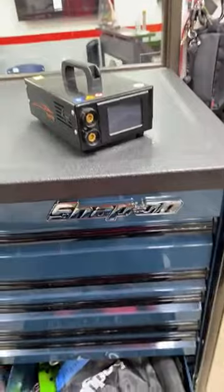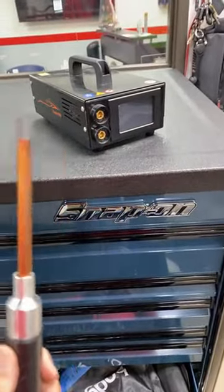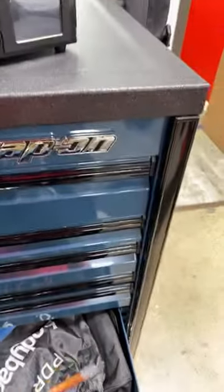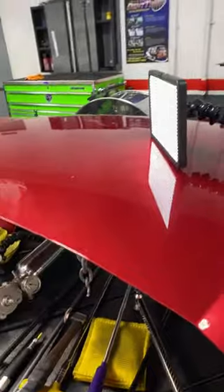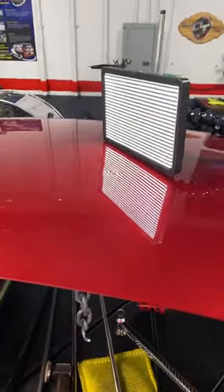Right, and we have to actually take the E-coat underneath on the bottom, sand it down, and then use this, and you tap it and or wave it around, and you'll see it tightens up the metal dramatically, and then I can go in there and finish it. It can turn a $3,500 loss into you getting paid, because a roof on a vehicle or a panel, let's say this aluminum on a Mercedes, you're talking $2,500, $3,500, but one stretch dent ruins it all, because they'd have to replace it. Does that make sense here?